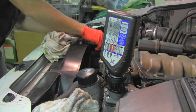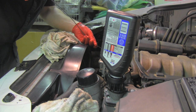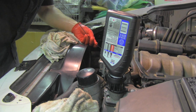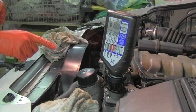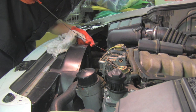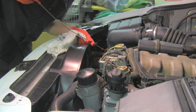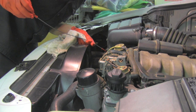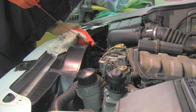After pouring six quarts I can see the oil touching the bottom line on the dipstick already, so I'll pour at least one more right now. I have put eight quarts of oil in this engine and the level is right on the top line just below — this is perfect.